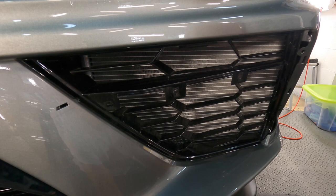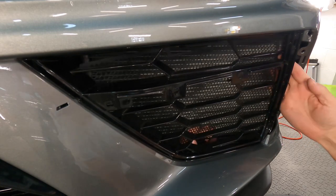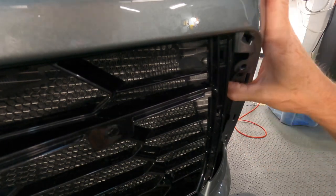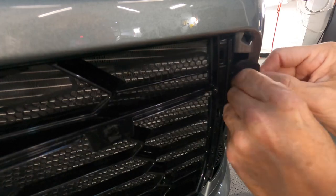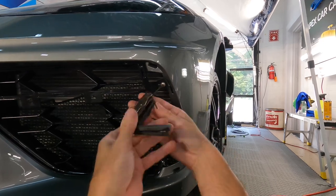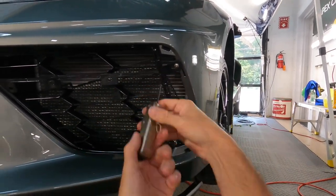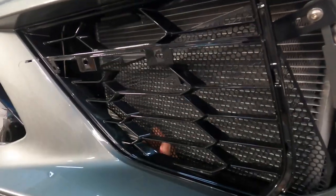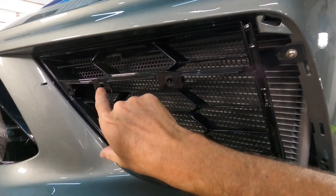The mesh grill guard will only go up in there one way. Take your time and gently get it up there without damaging the fins on the radiator and get it into position. Line up your first bracket right here — all the hardware is included — and snug it up. Next, we need to swing the other side into position. The tabs on the bottom with the double-sided tape will then make contact and start to take hold, and we just need to put in these screws.